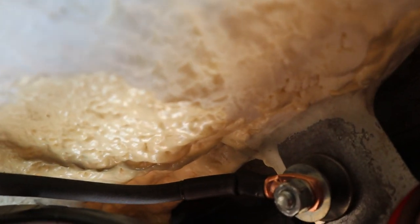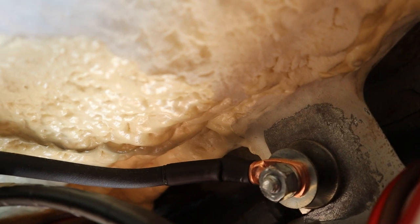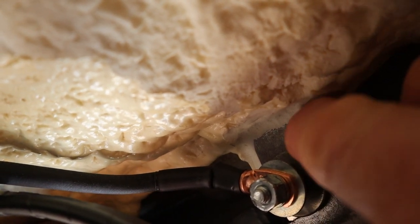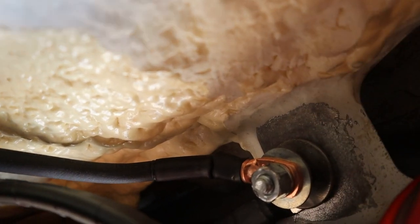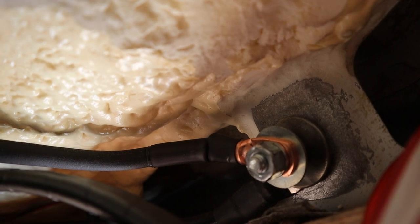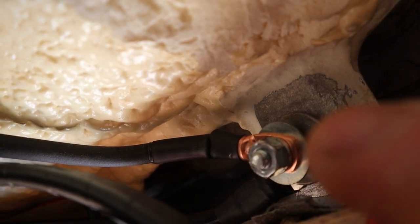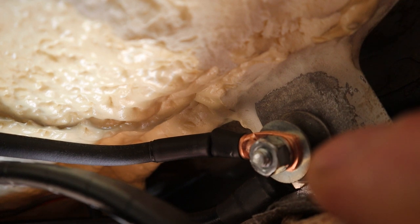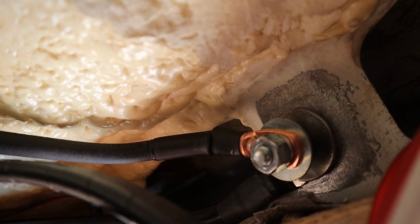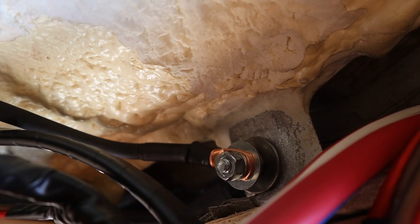Something I haven't shown you is my ground wire — my chassis wire that's connected to the frame. As you can see, the bare metal has been completely wire brushed all the way down. That first washer has got my main ground on there, then there's a lock washer and a nut. On the second one, there's 8 gauge going to my DC distribution panel. For the AC side, that is my chassis ground.